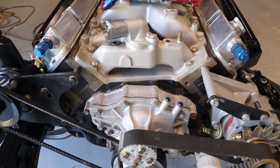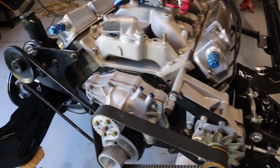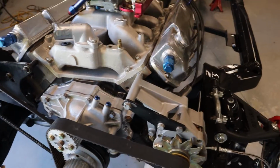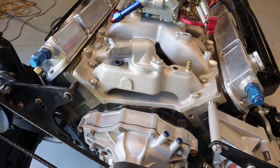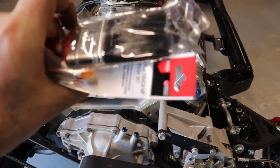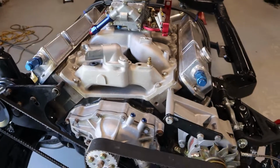Okay, so I've just cleaned up the heads, just any bare metal that's exposed, with a bit of Aqua Clean. I've just sprayed that on and used a Scotch-Brite and cleaned it up. So I'll just brush on the areas that are bare metal. I've got various brushes, just some little touch-up brushes. So I'll just brush it on, and leave all the bracketry on.